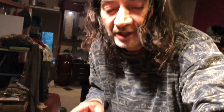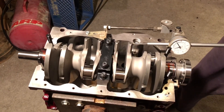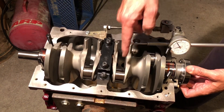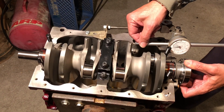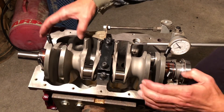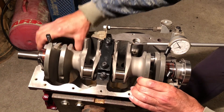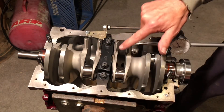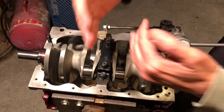We're going to show little clips as we put together our very special straight rod multi-web crank Sprite race engine. Here's the crankshaft going into the block. Certainly looks different, and for those of us used to the A-Series, it's interesting to see the rod journals centered in the bores. We've got a dial indicator set up here, and we've been fidgeting with this center MED four-bolt main cap. You've got to pay some extra attention. A standard cap allows the thrust washer to move around pretty well in that slot, but I had to chamfer the edges of the thrust washers to really ensure they weren't resting up on a corner.